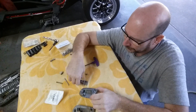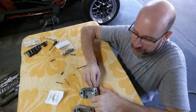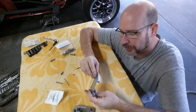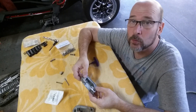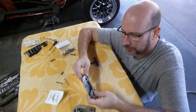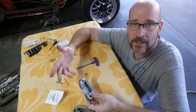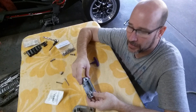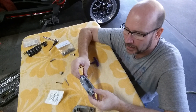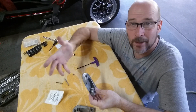If you polish steel it's just going to rust. So what I'm going to use is aerosol Dupli-Color engine enamel clear coat. I've used that stuff in the past on some little things under the hood and it's held up really well — it's pretty durable. I generally don't use aerosol paints on my restorations, mainly car paints on just about everything because it lasts longer and holds up better against chemicals, but in this case I'm just trying to keep something from tarnishing or rusting. I could clear these with automotive clear but it'd be thicker and would probably flake off easier, so I'm just going to one coat them with aerosol clear.